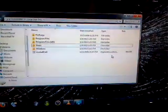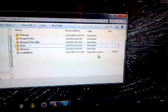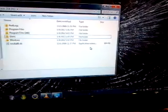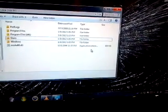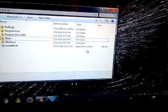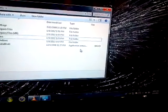So as you can see, the hard drive has to come out of the computer, come out of the caddy, get docked to the server, scan for viruses, and then all the information transfer over. And depending on how much, it could take some time. This is a 1 terabyte drive with about 200 gigs being used, so I'm going to be transferring roughly around 130 gigs of files over to a backup folder. It should take me somewhere around 40 minutes for me to transfer those files after the scan.